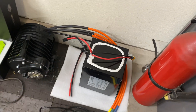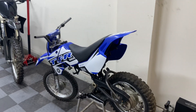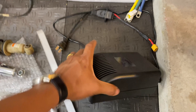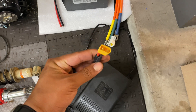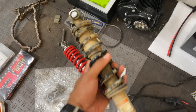For the battery I'm using an Emorge 20 amp-hour 72-volt with a 120 amp peak — it isn't much but it should be plenty to move this little tiny bike. Unfortunately it did not come with a charger, so I'm just using my 5-amp 72-volt charger by BTR that I use for my Razor. I made an XT60 adapter so we can use it to charge the Emorge battery for now until we upgrade.